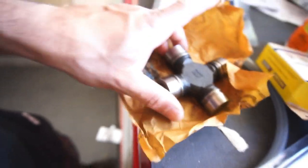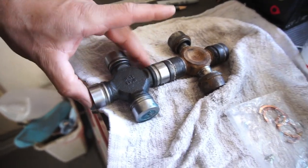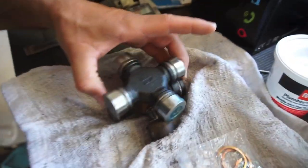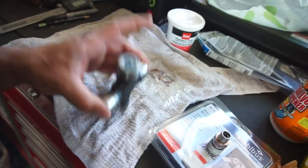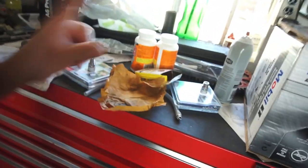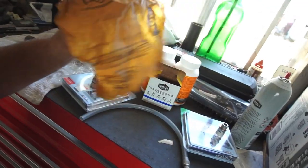She selected a 1992 Chevy K1500, and we have a U-joint. It is the same size cups, same size all the way around. So if you have a 91 K1500, it probably has a 92 drive shaft in it.